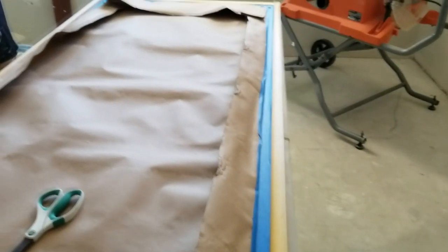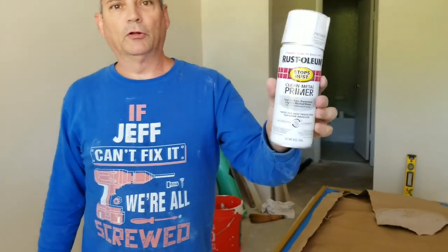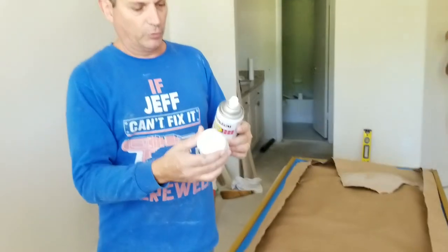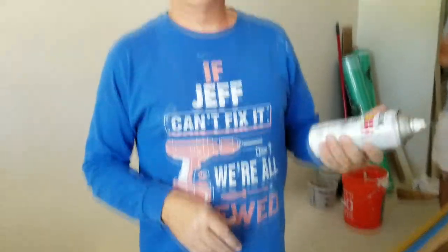Go right along the edge of the door all the way around and inspect to make sure that you don't see any visible part of the glass, and also make sure the tape is not covering any part of the metal that you don't want covered. Now we're ready to spray the primer on. We're using what we call clean metal primer — a special primer made for the type of smooth clean metal we're using here. We have white primer because we're going to be using white paint. Shake it up for about a minute and then spray.